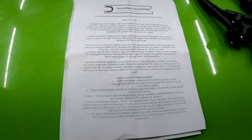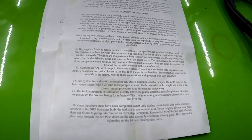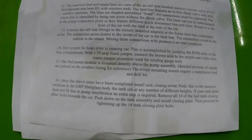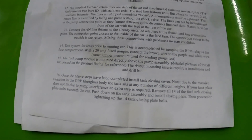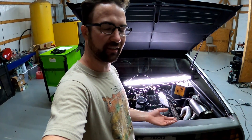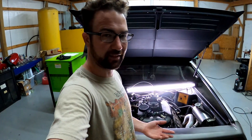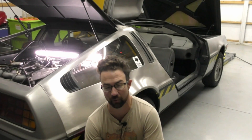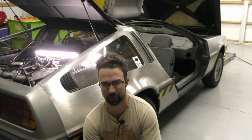One other note regarding the fuel tank on this vehicle: as I was going through and doing the fuel pump in the last video, I mentioned that I may need to lower the fuel tank in order to get the fuel pump installed. The instructions on the last page mention that due to variations in the fiberglass bodies, you may need to lower the fuel tank to get your fuel pump to fit. On the last video I was able to rotate it and get it installed that way, but know that if you're doing a fuel pump on your vehicle you may need to lower that fuel tank — it won't damage anything, it may just be necessary for clearance purposes. Thank you all for watching, there's more content to come.